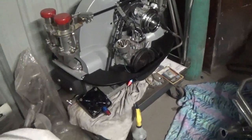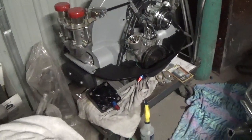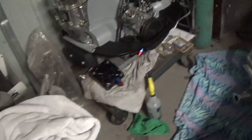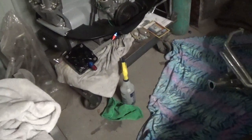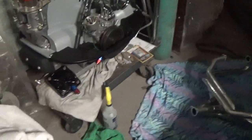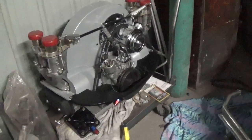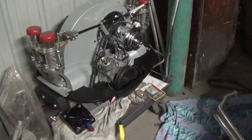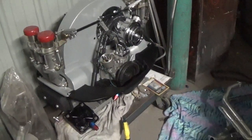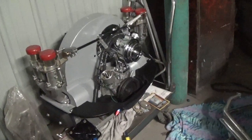We got to make a few intake manifold gaskets and then get those bolted down. Put the spark plugs in, which are down there on the cart. Got to finish bolting sheet metal up, and I need an alternator belt because we stole this one for another car. And we'll get this thing running.